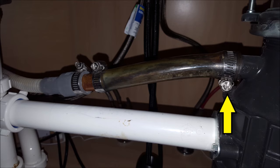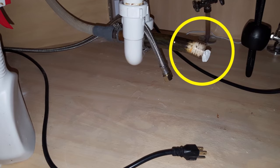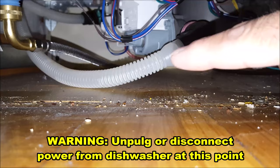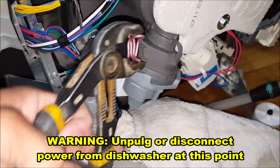Now it's time to loosen the hose clamp on the drainage hose and disconnect the hose, then check the ends of the hose and the garbage disposal inlet for possible blockage. If there is anything plugging the hose or inlet, a very small snake or a piece of wire could be used to clean the blockage. In my case, the end of the hose looks a little gross but there is no blockage. At the bottom of most dishwashers there will be an access panel with two screws that need to be removed, giving you access to the underside of the dishwasher, where you'll find the opposite end of the drainage hose. To remove this end of the drainage hose, it can be somewhat difficult because it's a tight space, but it can be done. The hose clamp should be a spring clamp that you can remove with a pair of pliers.